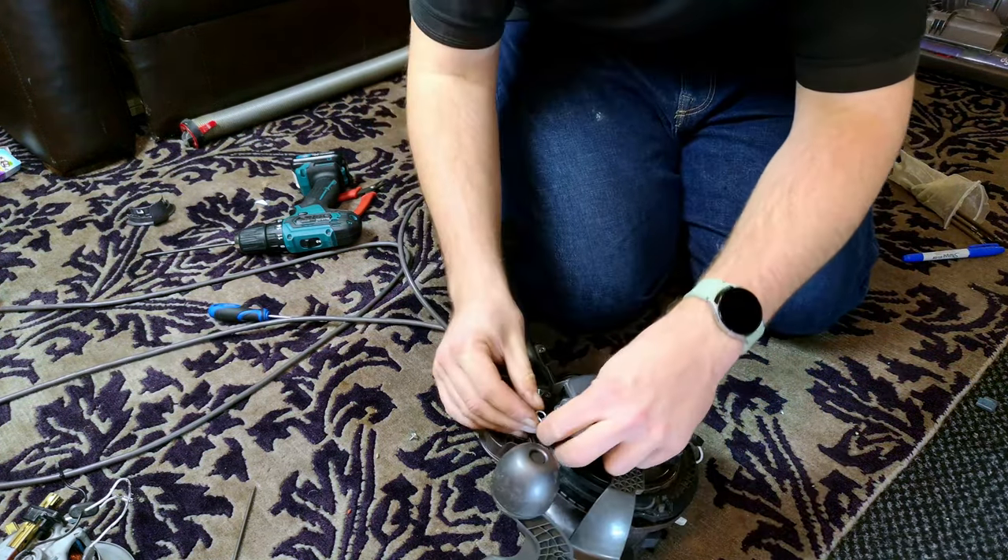There's only really one way to test if this mechanism is in place and that is to put these three screws in, then sadly you have to flip it over and put the other half-moon clamp on, because it holds it square - it will not work at all if it's not fitted, it will just bind and go off-center. If anybody has a really good way of doing this, please do let me know - this is one of the jobs I struggle with on the DC40. The DC41 by complete opposite is very easy indeed.